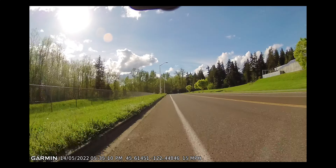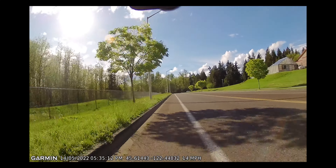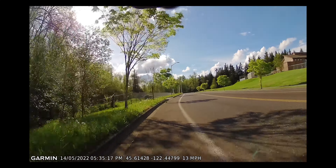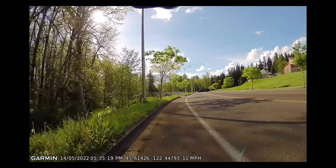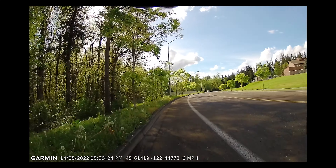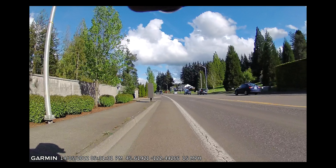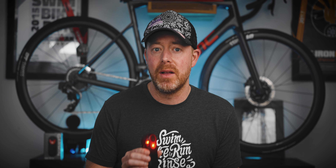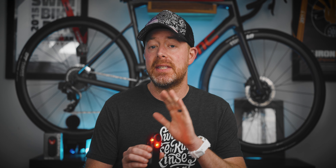What's new and unique about this product is the built-in camera. As a camera, you're looking at 1080p video at 30 frames per second. It has a very nice wide-angle lens — probably in that 16mm equivalent range, around f/16 aperture. So a very wide lens with a very small aperture; I wouldn't expect this camera to do super well in low light. But overall, the footage looks pretty good. You'll probably notice some fisheye distortion, but that's to be expected on these really wide-angle cameras.